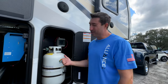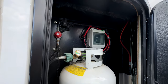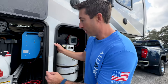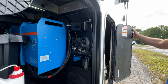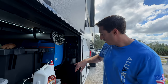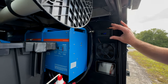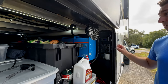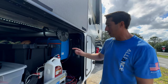In the propane bay, we have a 30-amp breaker for our deployable solar panels, and we also have gas stops — we're very serious about propane safety. We have a fan which vents into our propane area, one on each side, to create negative pressure. We've got a monitor for our Victron, four-inch 12-volt fans on both sides, and a thermostat with sensors in the middle that automatically comes on and off based on bay temperature to prevent overheating our Victron inverters.